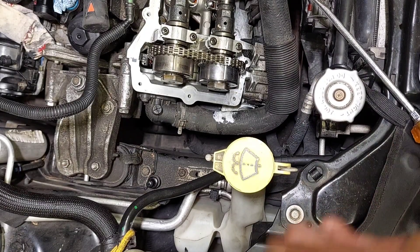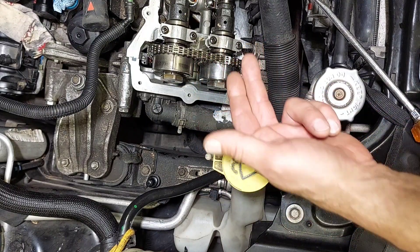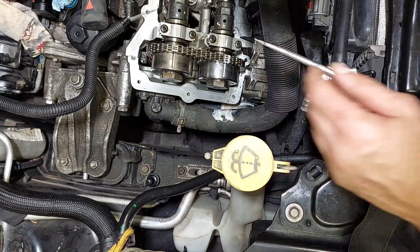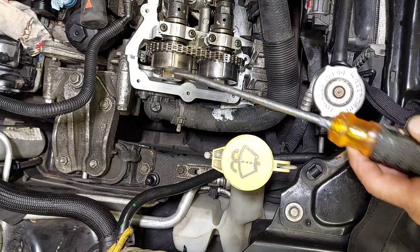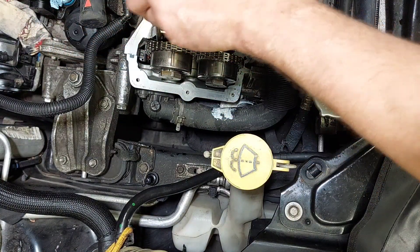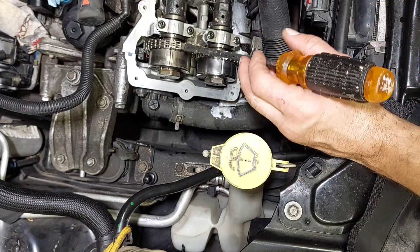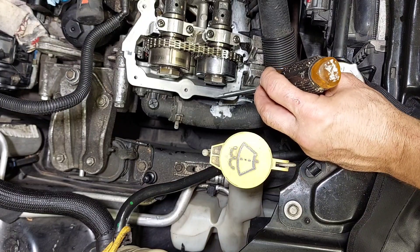Back to the engine — here's the new cam phaser. I made my own tool instead of the OEM one; it's a rod with a tight string used to release the hydraulic tensioner. I used a screwdriver on the side to push the tensioner back against the wall, had someone hold it, then jiggled the chain to line it up. Used an adjustable wrench to get the bolt through.